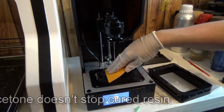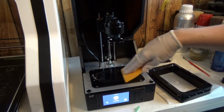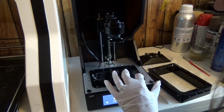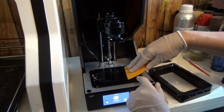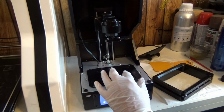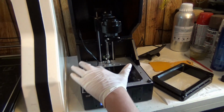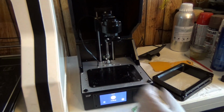Try to scrape up some of that resin using a scraper. I'm going for plastic, that way I don't hopefully damage anything, although as you've seen that doesn't always manage to be the case. Just be aware, if you aren't careful, you will start to peel up that tape around the outside, and that's not something you want to do. With a razor blade you can pick up things like resin that's really baked into something, but again, just remember that there's a tape around the outside of this, and as soon as you damage that, you're probably going to end up having to replace this whole thing.